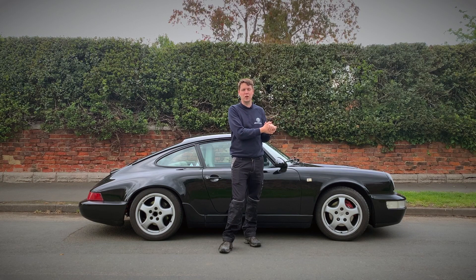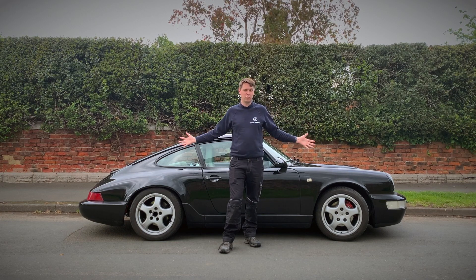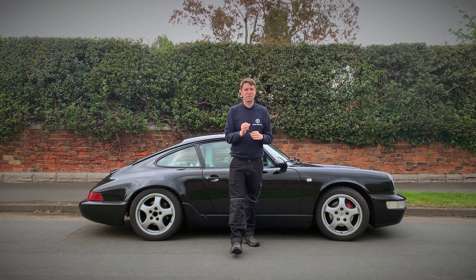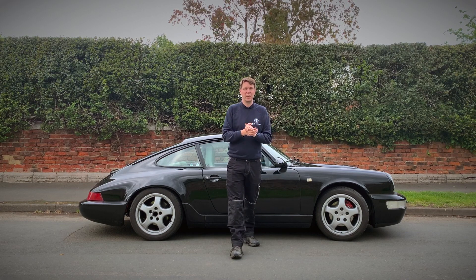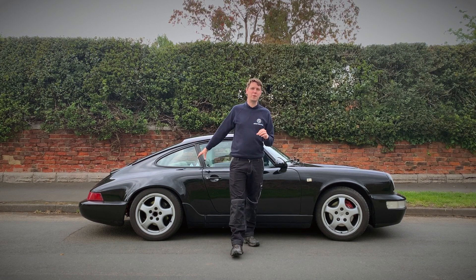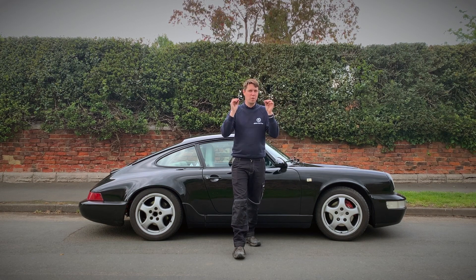The 54 kilowatt-hour battery pack is split — most of it is in the rear with a small amount in the front compartment, which still retains some storage space. The other great feature is rapid charging. This utilizes CCS rapid charging — one of the most common rapid-charging ports in the UK and throughout the world — doing 70 kilowatts. That means you can go from zero percent to 80 percent in just under one hour.